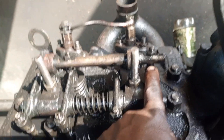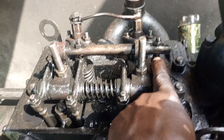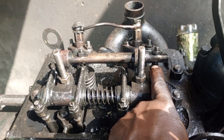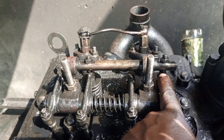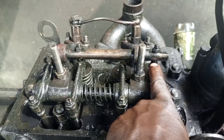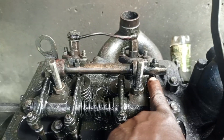So the decompression lever's function is to decompress the engine — to eliminate compression from the engine. It works on the intake valves: when applied to the intake valves, it eliminates compression. It's mostly used when you are using a winch or manual starting. That is how the decompression lever works — it presses down your intake valve. It's as simple as that. If you enjoyed the video, don't forget to give it a thumbs up, like, share, and subscribe.